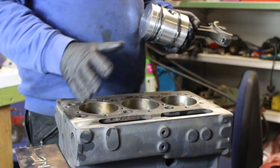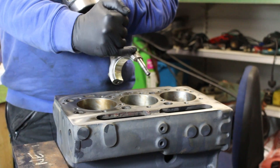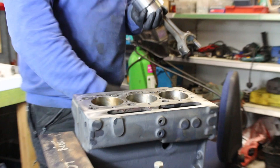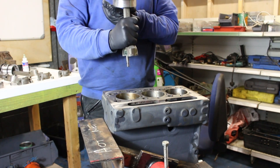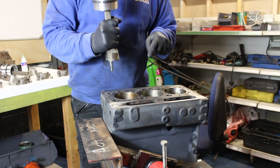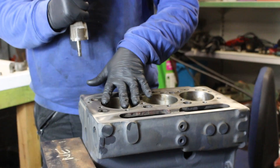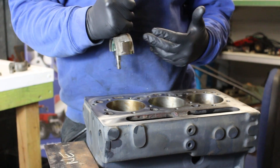When we took the engine apart we made note of which way around the connecting rods went. So I'm now going to do number three. This side here, where I am, would be where the injection pump is, so we know it goes that way. What I like to do is put the crank at the bottom of its stroke.